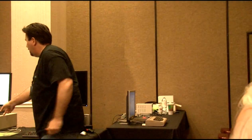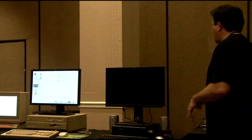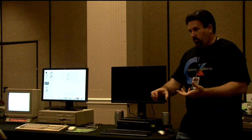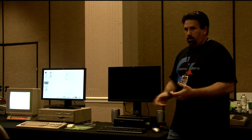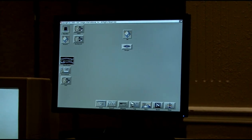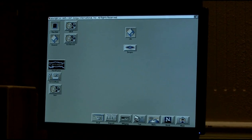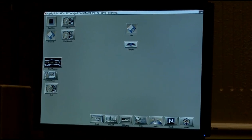This isn't a real Amiga 2000, but it has a board in it called a Vampire board — the Vampire 500 — compatible with the A500, A1000, and A2000. It literally plugs into the 68000 slot. You pull the 68000 chip out and plug this in. You can also take your 2.0 or 3.0 ROM out and throw it away because you don't need them. When you power up, it's a pretty fast Amiga — 111 MIPS. Compare that to your accelerated machine at 9.87 MIPS with a 68030. It has RTG built into it, supporting the Picasso 96 system. I'm working with the Apollo Core team — they contacted me because Fusion, my Mac emulation, didn't work.